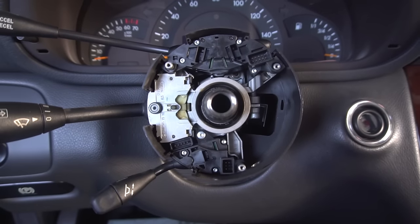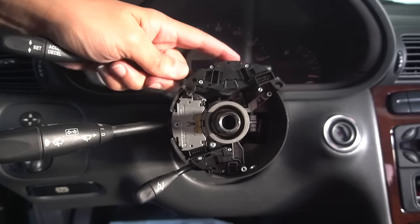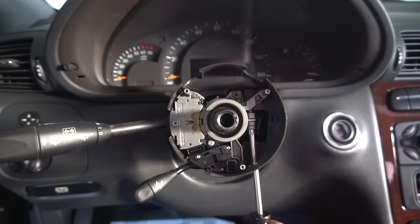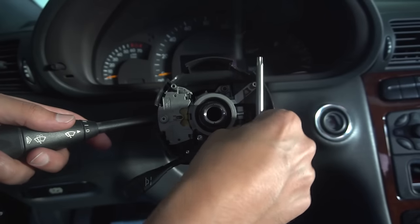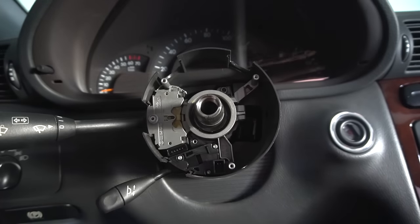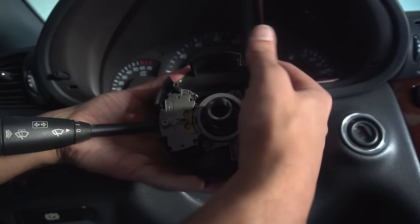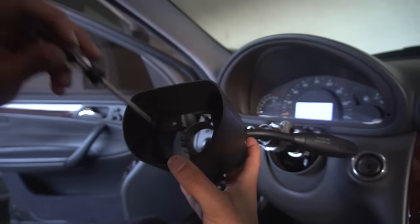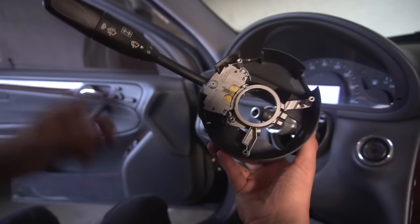Remove the plastic clips surrounding the various switches. There aren't any screws to remove the steering angle sensor — just pull back. Here is a view of all the switches and toggles. You can remove the top one first, which is the cruise control. Using a T30, unscrew the combination signal switch. Since I have an electronic steering wheel position, I unscrewed a Torx T10 to remove the bottom toggle. Next, wiggle the entire column out.